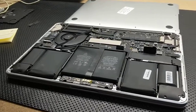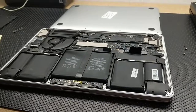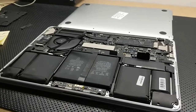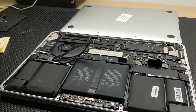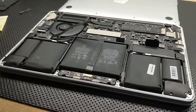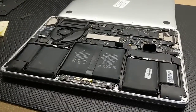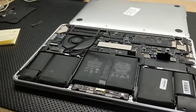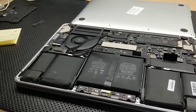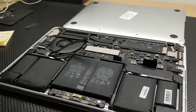So I was scratching my head on that. Looked into it — checked the keyboard flex, the pins on the keyboard power pin, which I believe is pin number five. All of those checked out. Really, really strange. Went back and double-checked on the other unit and everything worked perfectly fine there.